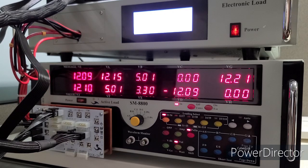Putting twice the power on a single cable causes enough resistance to drop the voltage — that's just Ohm's Law. Whether it's enough to impact performance is why we're here. For the 16 gauge wire I'll be logging results in my notepad. I have three of each cable and will run each test three times — 18 gauge, 16 gauge, and extensions — then average them out to rule out damaged terminals or other anomalies.